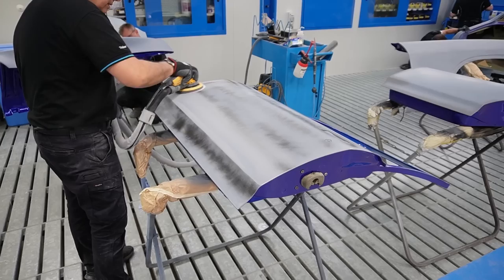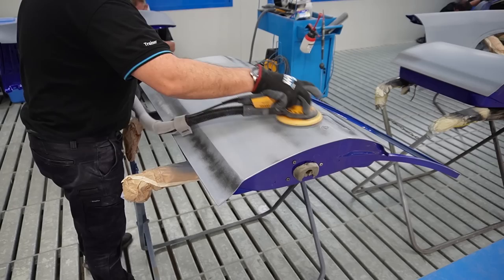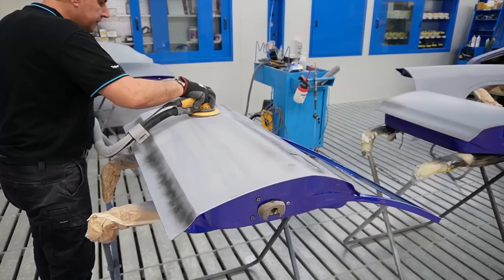That's been primed, so now this is the final finish. This has already been blocked twice, and this is now with a very fine abrasive. Again, we want to avoid painting over straight line scratches. Electric sander, 5mm orbit, very important. This makes sure that when we put our base on, there are no surprises as far as straight line scratches showing through. That happens a lot in silvers, as you've judged for many, many years in this high end area.